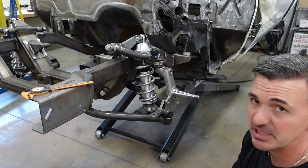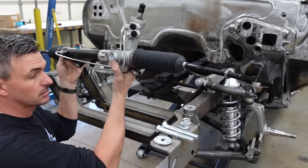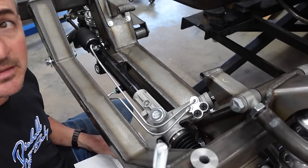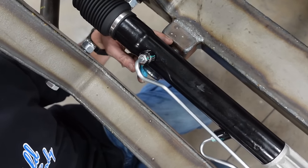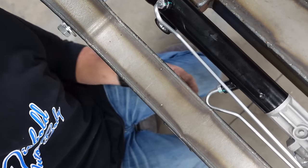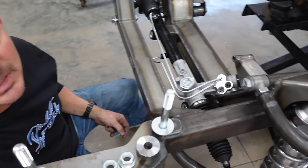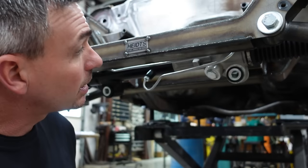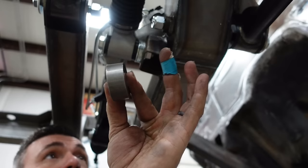There's the lower control arm and coilover installed. Now I've got the upper control arm — get it set, get the spindle on, bring the control arm back around and line it up. Be careful not to cross-thread the bolts when jamming it in. That's your whole complete left front suspension. Now we're ready to put the rack and pinion in — I've got it set up, but sitting in here tight, it's hitting the frame right here.